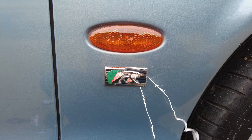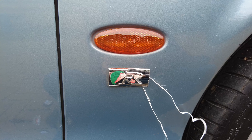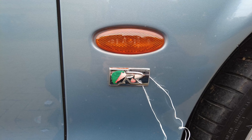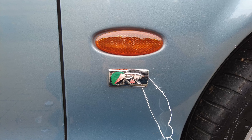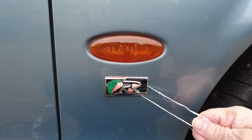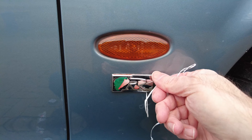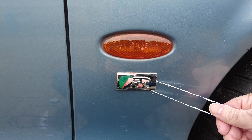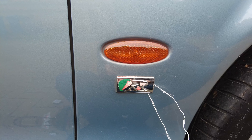The floss will probably break if you exert a bit too much pressure, so I've just doubled up a couple of lengths. What I'm doing is, every so often, I'm just reheating it because it's very cold today, just to keep the glue nice and sticky and easy to break down. I'm nearly done — just being careful that the edges aren't catching and damaging the paintwork, being really cautious about how I proceed.